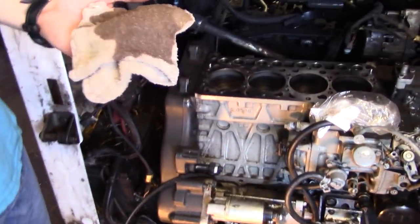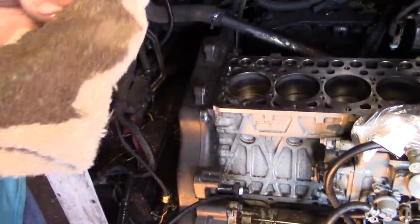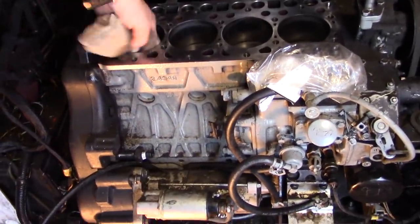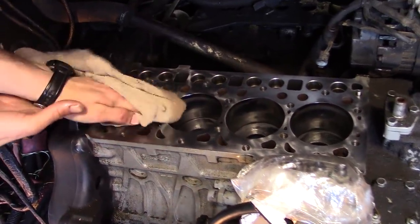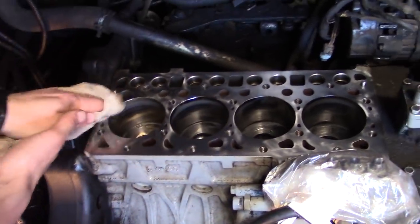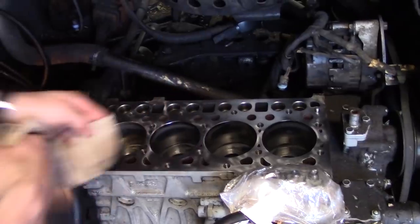Sydney's going to be working on this morning — I'll be here to show you guys, in case he needs another hand. I'm going to just lightly oil the cylinder walls with oil on a towel, just to make sure there's a little bit of oil there before we start it. What do you use to clean that with? I prefer carb cleaner. Brake cleaner works. I've used paint thinner, and while it does take off old gaskets, it doesn't dry.